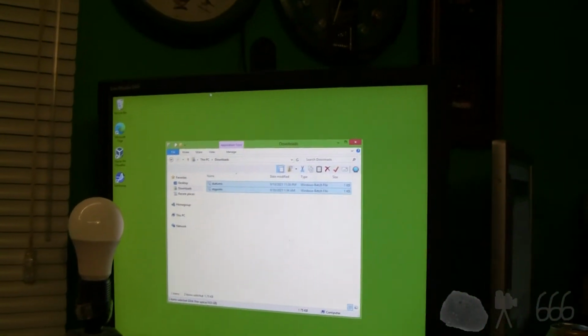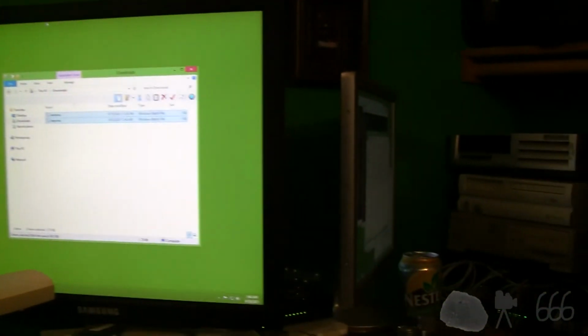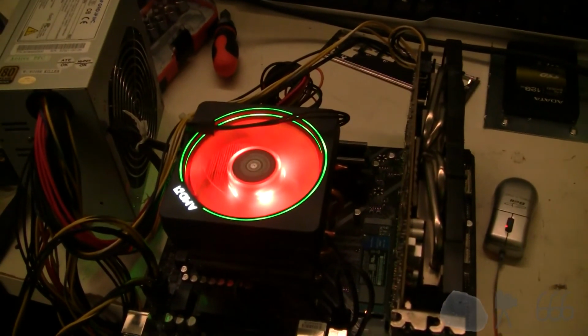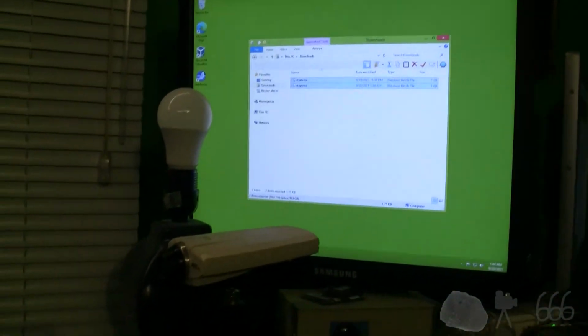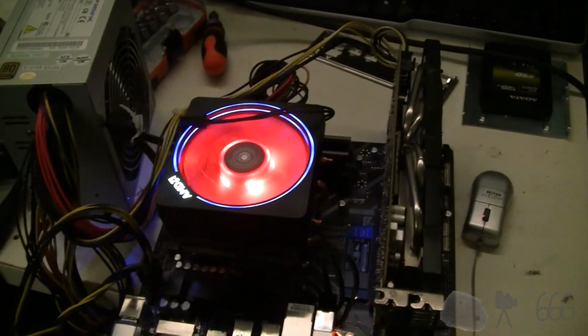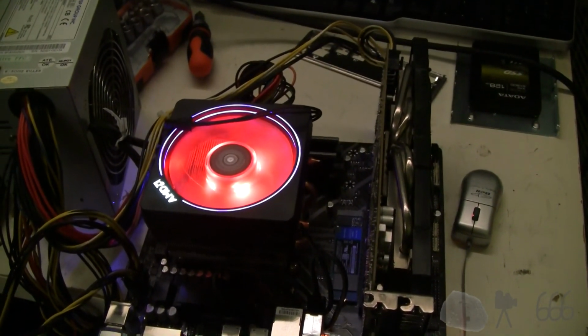Okay, a couple of problems here that'll preclude my being able to simply clone the old install to this new hardware. Number one is that when I shut down the old machine, I'll have no PXE boot server, because it's on that system, so it takes away the ability to do it that way. And the other issue is that this new hardware, I believe, is new enough that UEFI and Secure Boot and all the other stuff may pose a problem. I know UEFI is on, I know you can turn it off, I know you can do all of that kind of stuff, but I'm not going to bother, because it seems like it's kind of a bother.